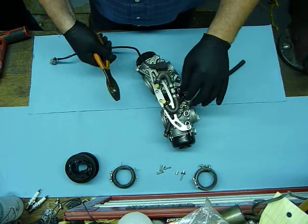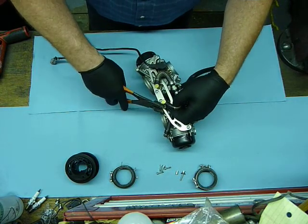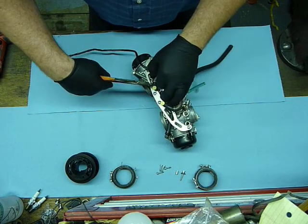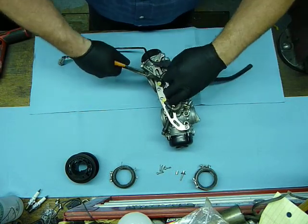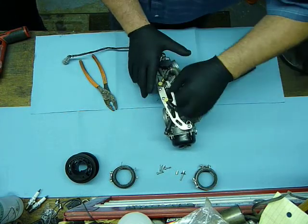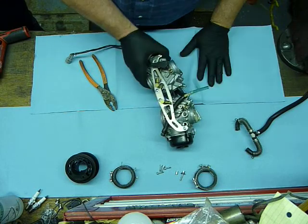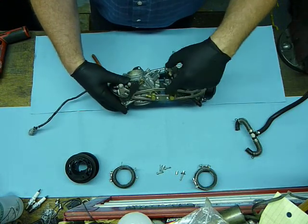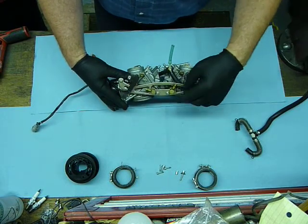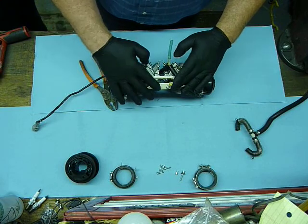These are the fuel lines. We're going to get these off of here and get them out of the way. Notice that these guys slide a little bit. Dependent upon how long the carburetors have been sitting, sometimes the O-rings that are behind the bridge here will start leaking, so this may or may not be something you want to deal with.